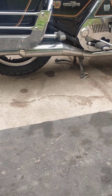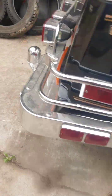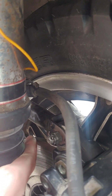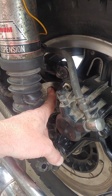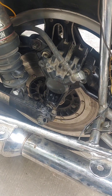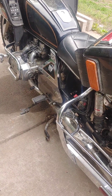You can change your rubber — there's tons of videos on that — and then bring it back in and reassemble everything the way I showed you. One other key factor: this arm goes in one way and only one way because this clip has to be on top. If it's on the bottom, it will bang on the brake assembly right here on the disc. So this arm needs to be put back in with the brake line holder in the right direction. Have fun. Thanks for watching. This was Fix-It for Josh's Sake — I'm Josh. Love helping my fellow wrenchers figure out how to get back on their bike and get things running right. Have a great day.